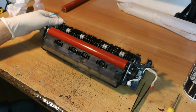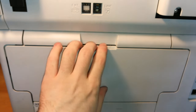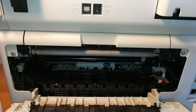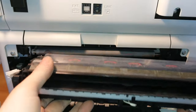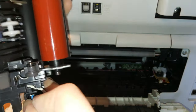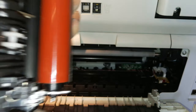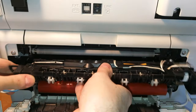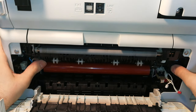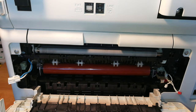Now we can take this back inside the printer. Let's get the printer back and reinsert the fuser unit. A bit of compressed air here to remove all the black debris from the broken roller. Before putting the fuser unit back inside, remember to reconnect this connector that we disconnected earlier — just in case you didn't reconnect it before, like me. Let's get the fuser unit back inside — everything seems to fit correctly. Let's get the screws.